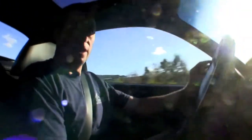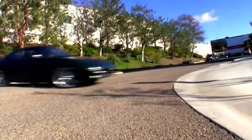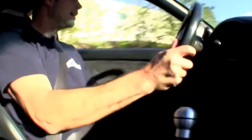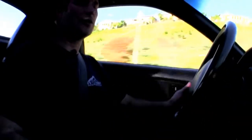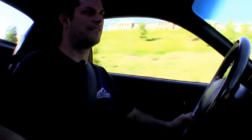This is one of our favorite cars. Plenty of torque. I just started out in second gear and the car's pulling real good. Let's even have a little fun in this thing. Again, the great thing about electric cars is the instant torque, the low center of gravity with the battery pack, and it's just fun to drive. So that about wraps up our drive on the MR2. We have 38 cells in here. We're using the Thunder Sky 260 amp-hour cells and the car gets about 100 mile range, a little bit more than that, but this particular customer likes to drive it around and have fun in it, not drive it so lightly.